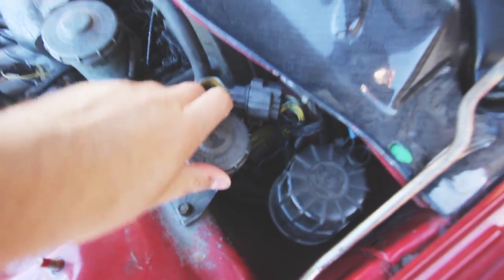What's cracking guys, welcome to another video. I'm here in the garage - I gotta go through what I usually have to go through every morning when I drive the Del Sol. Kind of annoying but let's check it out. As of right now the Sol is running pretty legit, I'm just trying to get this engine bay looking how I like it, but I have to deal with this all the time where sometimes I turn the car on and I have no clutch or it feels like it's slipping. I've kind of got it figured out - almost every morning I gotta come in here, check this clutch fluid, see how it's low. It's just always low.